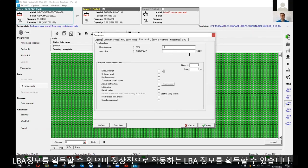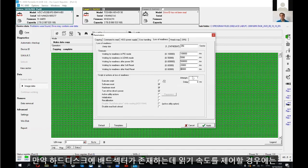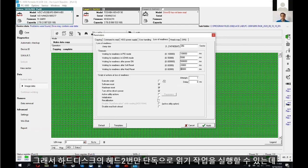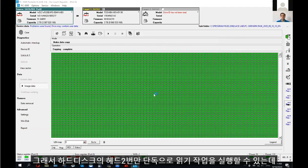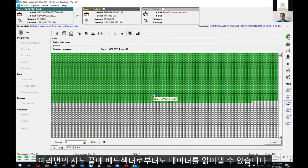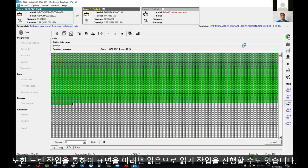I am also going to play with timings to improve results, because sometimes if our head's copying speed doesn't fit into the timing process, there might be bad sectors. But if we increase the timings and read the data more slowly, probably fewer bad sectors will occur. I am starting with head number two only. The copying process goes very slowly and we get a lot of bad sectors, but during several rereading attempts, we can read data even from bad sectors. You can see a bad sector that after reading attempts becomes a green sector — so very slowly we can move forward and reread the surface.